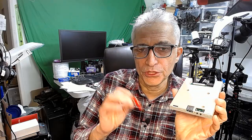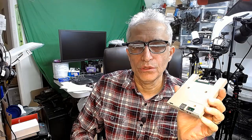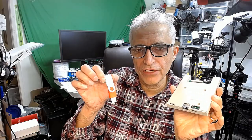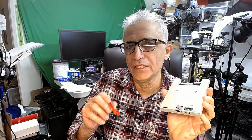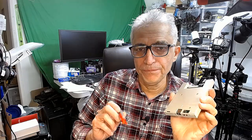There are certain limitations on your equipment that limit it to the capacity of the floppy. For example, if your machine can only see up to 1.44 megabytes, that's the only amount of data you can see at a time — even if you have an 8 GB flash drive. If your equipment only supports 720 kilobyte double-density, that's as much information as you can see at a time.